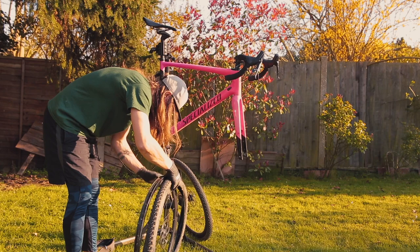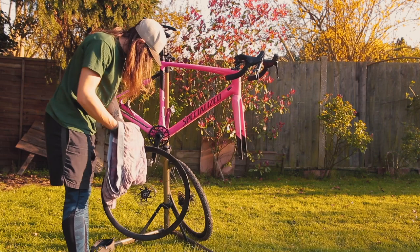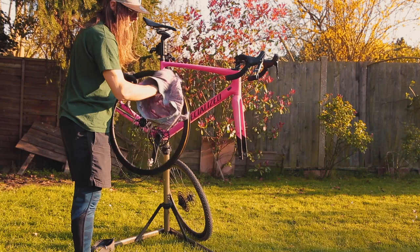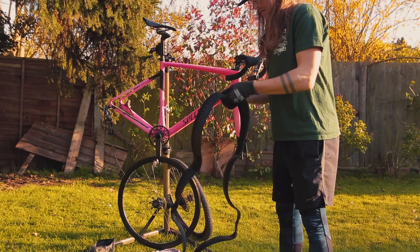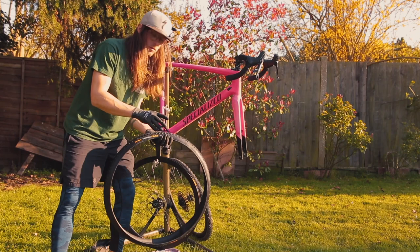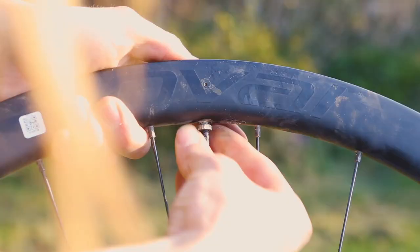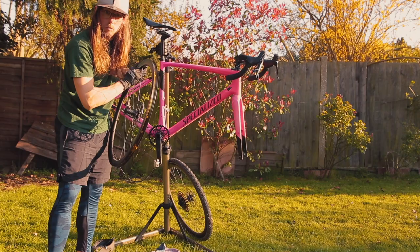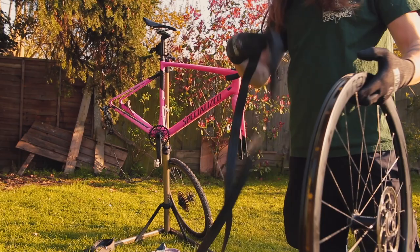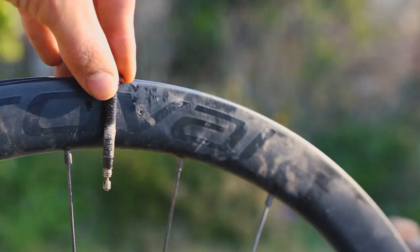You can wipe things down with whatever you've got handy — it won't scratch. Old pair of boxes work fine. Give the tires a good bend out if they've come folded. If you're going to photograph your bike a lot, make sure the brand label is always above the valve hole — that gets you five cool points for every picture. One important thing: make sure you remove the valve core, otherwise you're not going anywhere. The valve length shown here is perfect — always check your valve lengths.